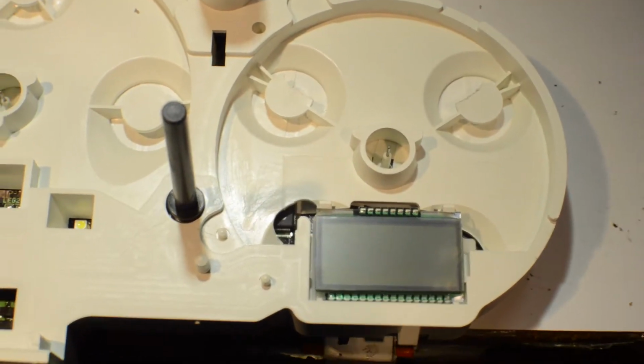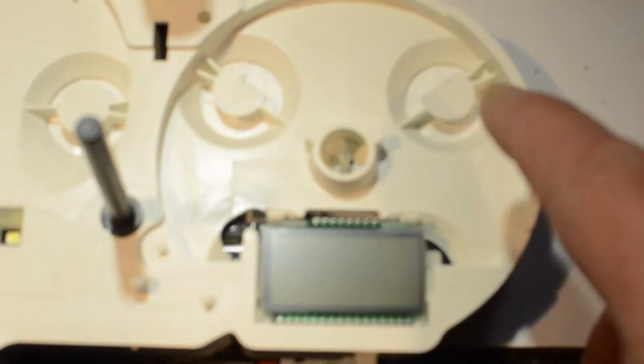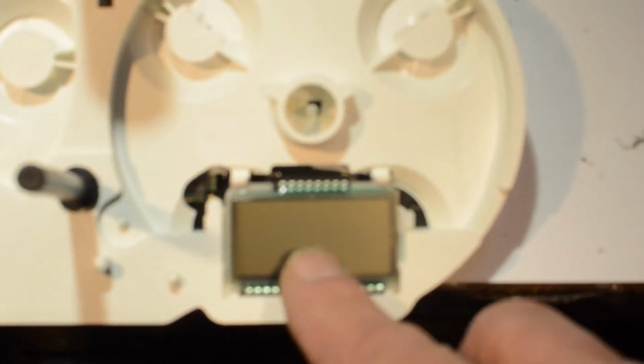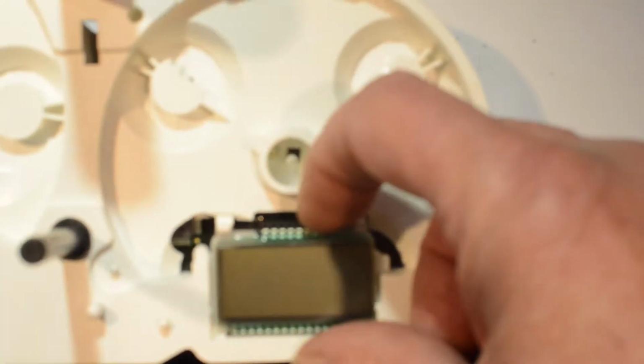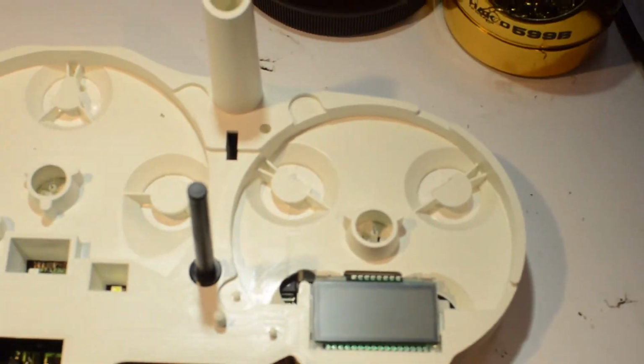After going to the car and lighting this up, I forgot that when we have one color for the gauges and another color for the LCD, we must take some white tape and generally apply it in a strategic method so the red doesn't bleed into the bottom part of your miles per hour. So that's what we'll do now.